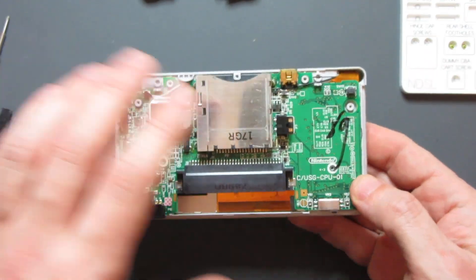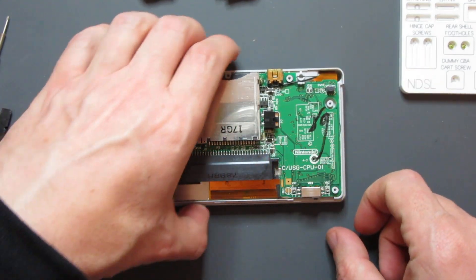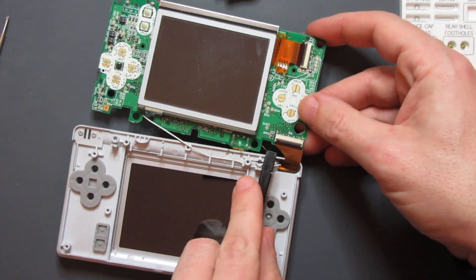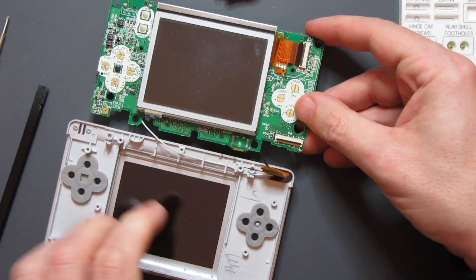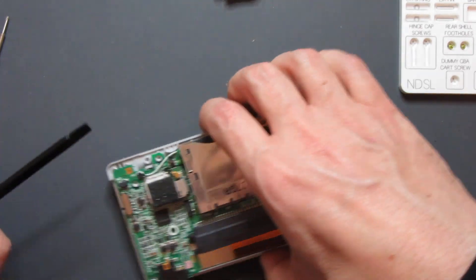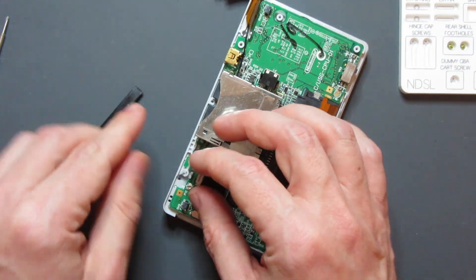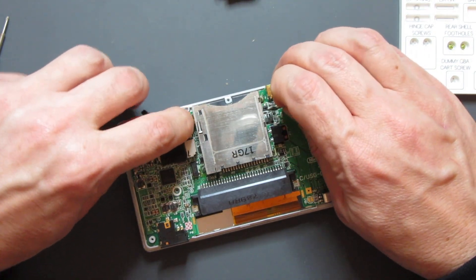So that's all the parts neatly arranged. Now we can get to the hinge parts and the ribbon — both are under the motherboard. To take the motherboard out, remember the lower screen is attached via a quite delicate ribbon. I find the easiest way is to open the hinge a little bit and lift from the screen side, and it'll just pop through. Flip it up and over — this little tab here lifts up with a spudger or fingernail and then carefully pulls out. There are also a black and white wire attached at two points which just lift off.